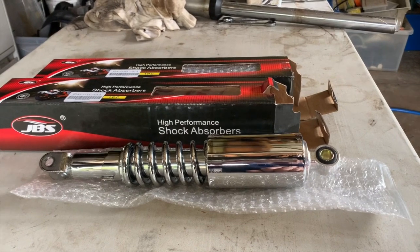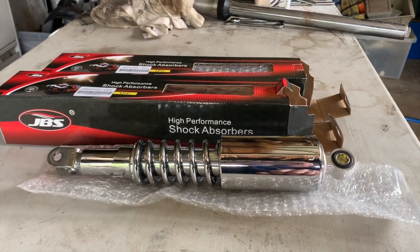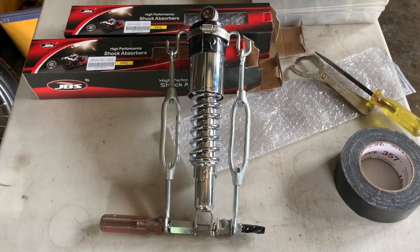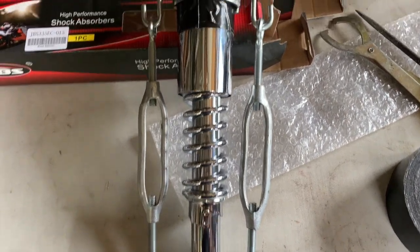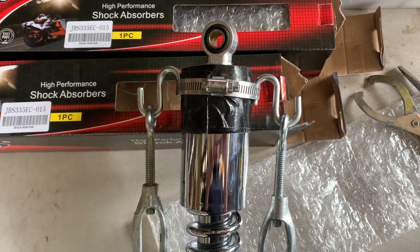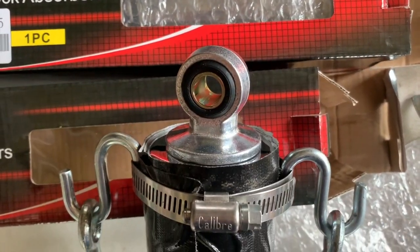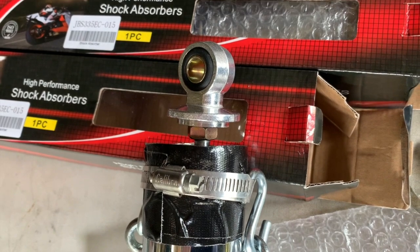The next step is to try and come up with some jig to compress those springs, similar to what I did with the original ones, and see if I can get that chrome cover off. So this is my setup: a screwdriver through the bottom, spaced out so the turnbuckles don't hit the spring, some gaffer tape around the chrome cover, and then hooks screwed on there with a big hose clamp. Hopefully I can screw these down and pull that down far enough to undo however this goes on and get that chrome cover off.